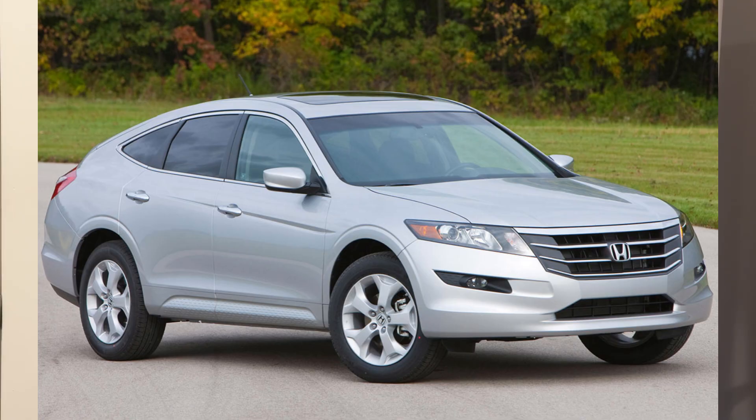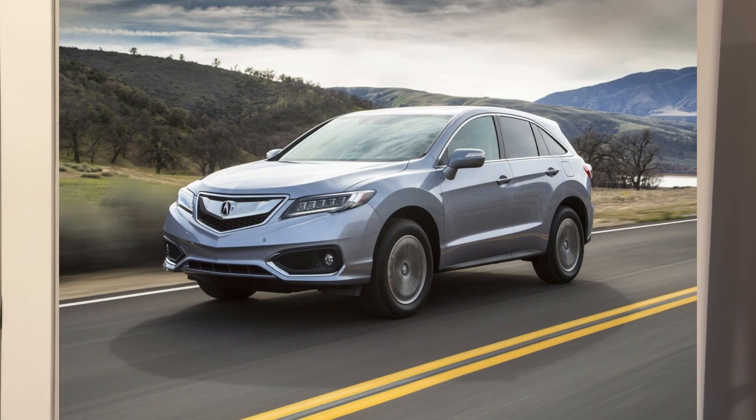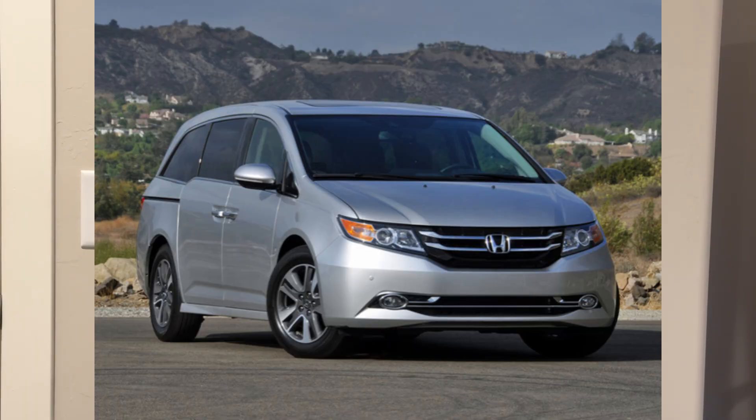In this video, I'll just use the term VCM-2. Next is VCM Version 2. It starts with the J35Z2, which is on the 2008 to 2012 Honda Accord, 2010 to 2012 Honda Accord Crosstour, and 2013 to 2018 Acura RDX. Also the J35Z4, which is the 2009 to 2015 Honda Pilot, and the J35Z8, which is on the 2011 to 2017 Honda Odyssey. VCM Version 2 starts off in six-cylinder mode and can also go into four-cylinder mode and then three-cylinder mode, depending on the load placed on the engine.